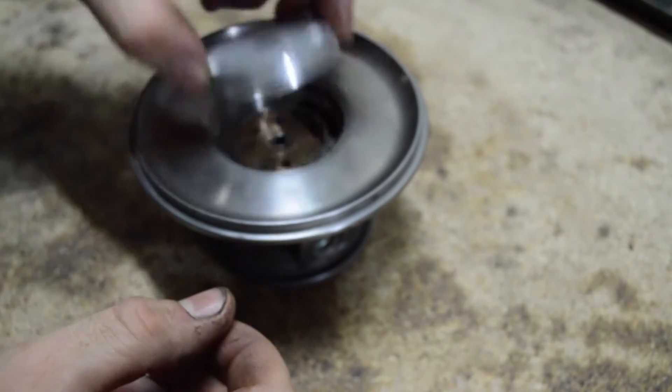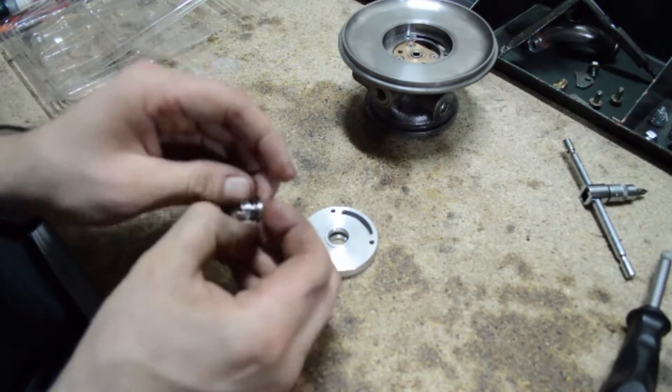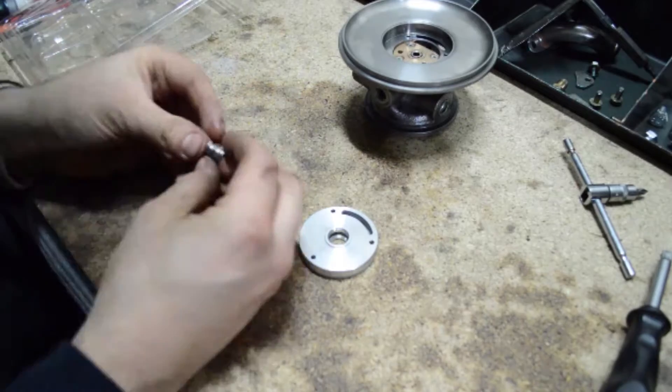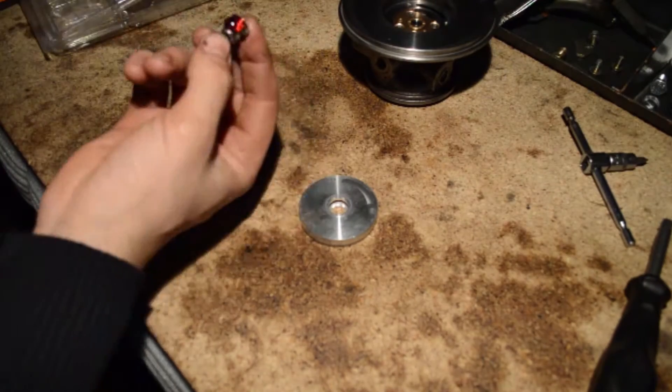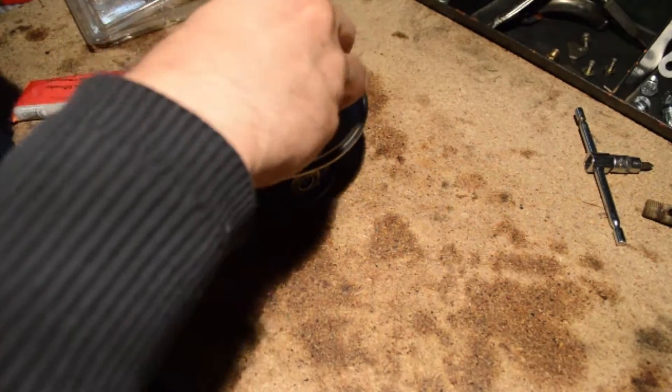Now comes a new bit. I've had to change the old seal with an aluminium seal, which apparently is stronger than the old unknown material that came out of it. The piston rings go on the thrust collar, and then the thrust collar is placed in the seal. The seal was then placed in the turbo core and bolted into place.